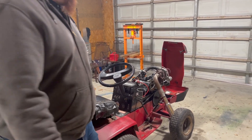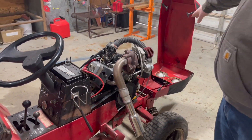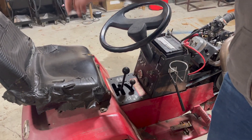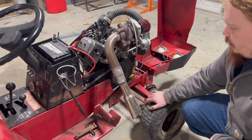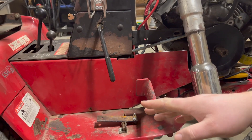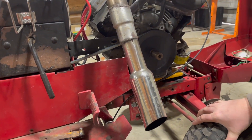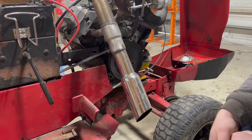Let's come around and talk about the chassis and the belt and pulley setup. This is a Wheel Horse garden tractor with what they call an eight-speed gearbox — a manually shifted three forward gears and one reverse with a high and low range. This thing was meant to pull a plow or push snow. On our turbo engine we've got a larger pulley — I think it's a seven-inch pulley — with the factory rear pulley. That seven-inch front pulley with three forward gears in high and low range gets us to about 15 miles per hour, which for a stock old garden tractor is quite a bit of speed, especially for riding around car shows.